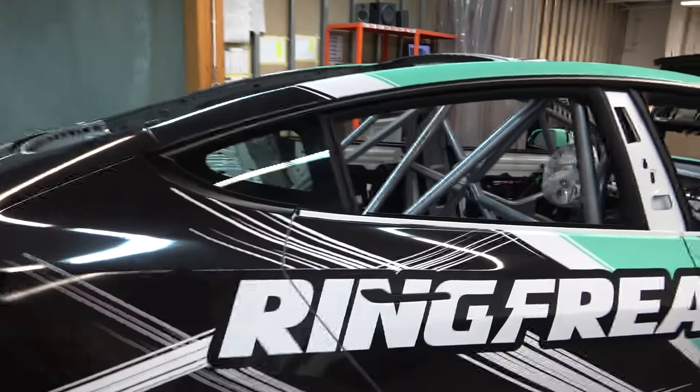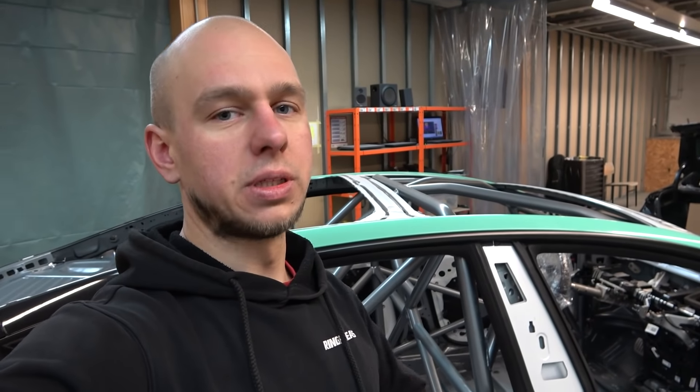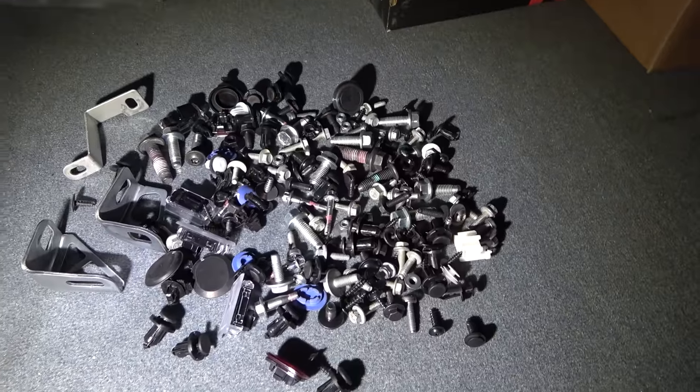The car is back on wheels and in the workshop with a completely empty interior. The goal now is to install all the wiring inside, but we won't tighten it fully — just drop it in, connect everything, and try to drive the car as-is to check what we can eliminate and what we need to keep. I'll start from the biggest parts like the charging cables, additional battery mounting parts for the front, the modules on the left and right side, then go to smaller bits. There are many bolts and I don't always know which goes where — it's a game but it will be fine.